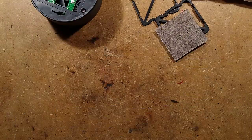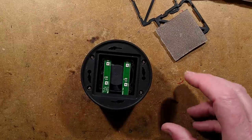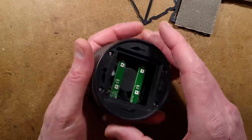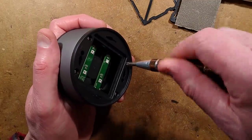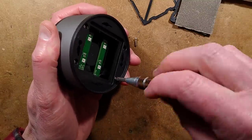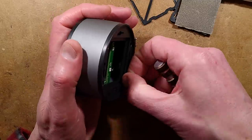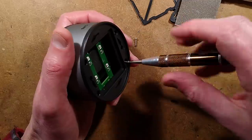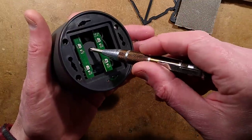Let's open this up. I'll focus on this to bring things up to a predictable level without having to swear at the camera — like AVE does on such a regular basis. Let's unscrew this to see what's inside. I don't think there's a lot. I guess the new version has more LEDs. I shall test these LEDs — the current was only about 270 milliamps. About 4 LEDs at 50 milliamps each, plus a little bit for the fan.